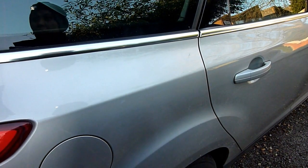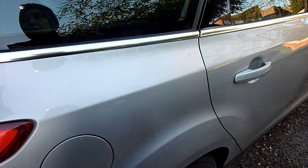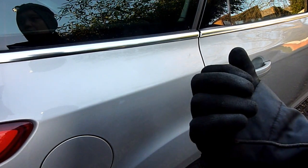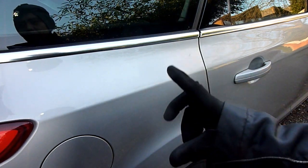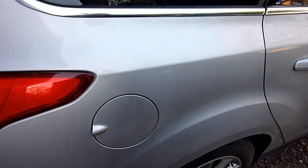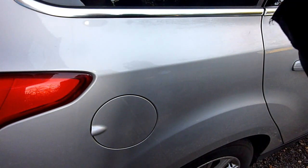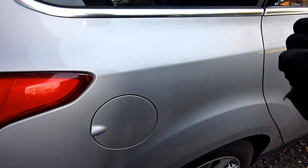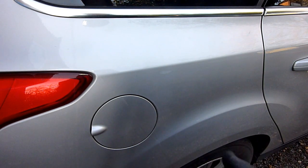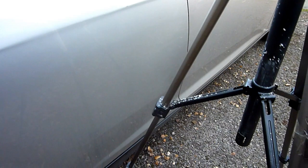One last thing just before your test: especially if you're in European parts of the world, make sure you've got a set of spare bulbs for all lights around your car, a set of fuses, a warning triangle in case you break down, and a high-visibility vest. Also, fill your car up with lots of fuel. When your car is very low on fuel it can actually trip the limp home mode. Make sure your car has at least half a tank. Thanks for watching — if you've got any other ideas leave a comment below and I'll pin it to the top.